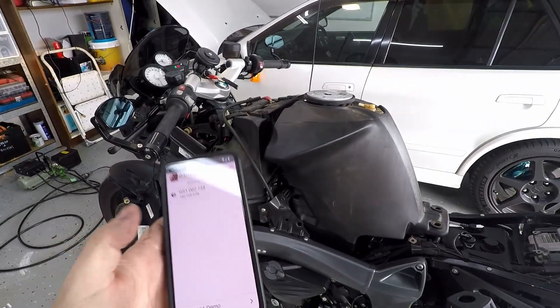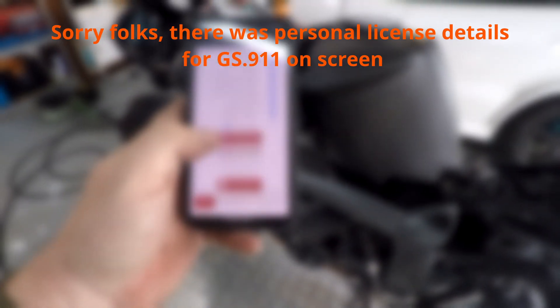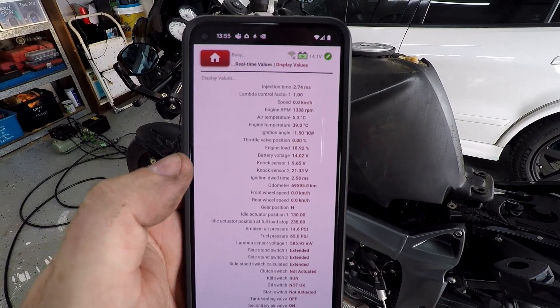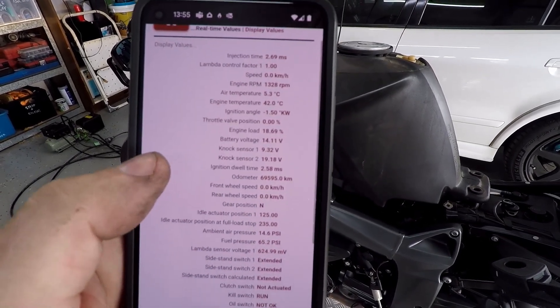I could say it smells a little richer. Yeah, five degrees — looking at the additive trim bank, it used to be around one percent when idling, and now it's 0.3 percent because it's already getting a rich mixture. So it's definitely running richer but it's not adding as much fuel on top. I guess now the only thing to do is ride it.